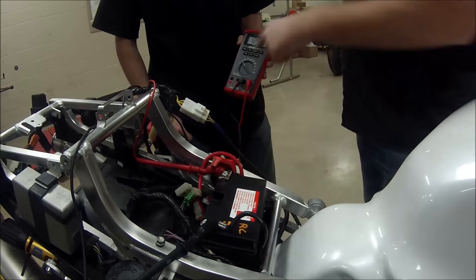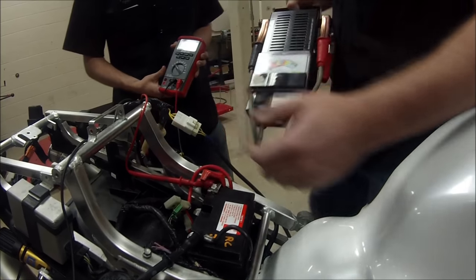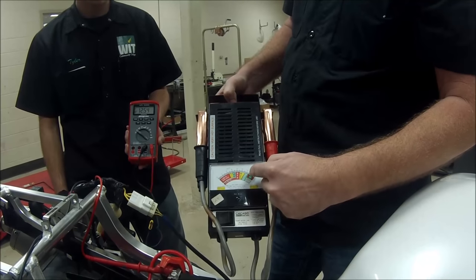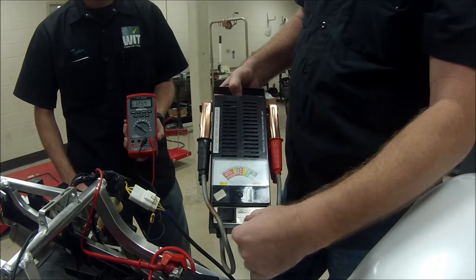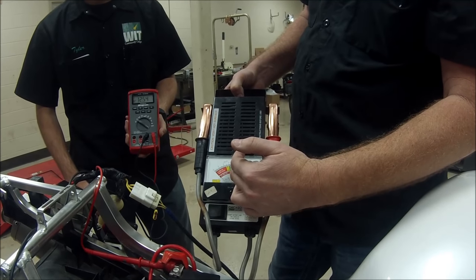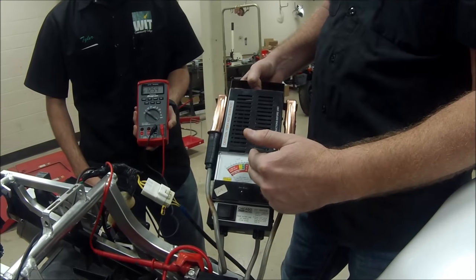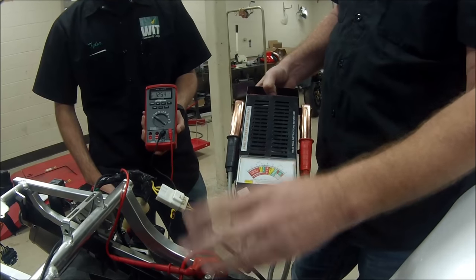What we don't want to do is consider that voltage reading alone to mean the battery's good. From there, what we do is a traditional method using a load tester. With the heavy-duty clamps on, battery out of the machine, this gives us our surface voltage reading. When I hit this button, it cranks down an internal load to see if the battery falls below 9 volts — if it does, it will register bad. Maintenance-free batteries typically fall to about 10 volts; conventional batteries fall to that 9-volt range.